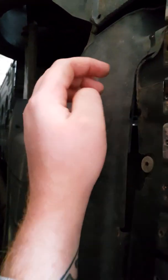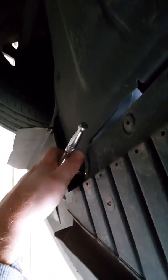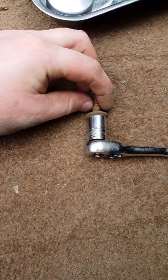As you can see, you've got screwdriver points. They're also on the tray on this side, and same as the other. In this corner down here, this one's actually not got a bolt in. But down here, on the other side, there's a 10mm. And at the back of the tray, just over there, there's 10s on each side. Just remove them and drop the belly pan off. Just a little update: the two bolts at the back, for the belly pan, are a 13mm.